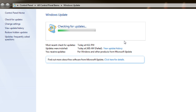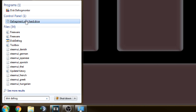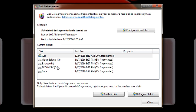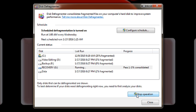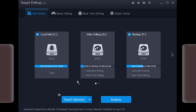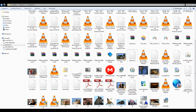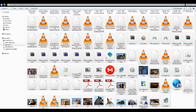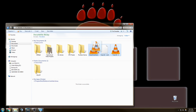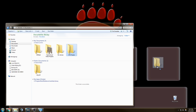Once completed, make sure to do a little more cleaning. Start by running a disk defrag, which will help increase your hard drive speeds. You can do so in Windows 7 by clicking on the start button and searching for defrag — it'll pop up as Windows Defragmenter. You can also use third-party software like IObit's Smart Defrag, but the built-in Windows one will do the trick. Consider deleting old documents, pictures, and any other files that could be bogging down your system. Go through your hard drive and check the My Documents folder especially, as it is the default download location for a lot of different things.